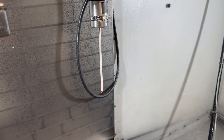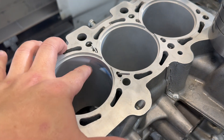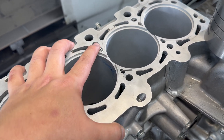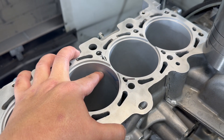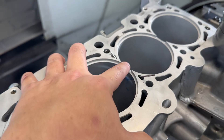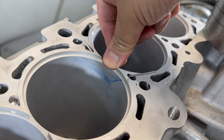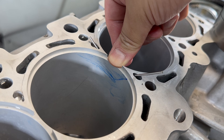With precision machining and precision measurement, we can make sure you don't machine off-center and leave a hole. But even without a hole, the remaining wall is probably less than 0.5 millimeter. This reverse triangular shape is weakened — think about it as a bridge. The head gasket in the cylinder head will sit tightly here, and sooner or later it's going to collapse, especially during operating heat.